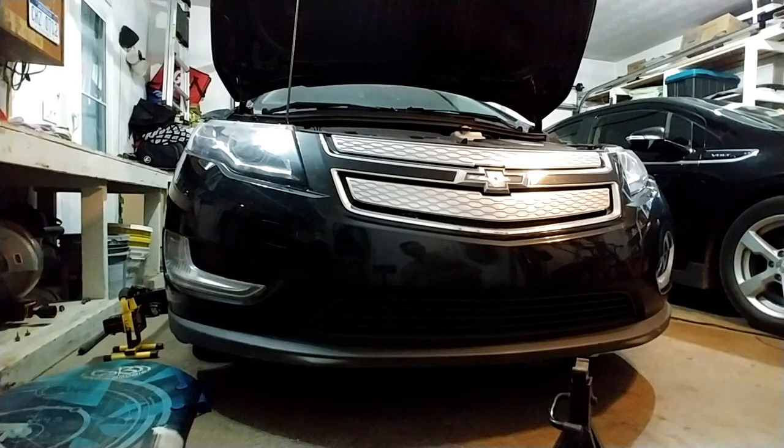All right, the next step is to drain the coolant. In order to drain the coolant from the engine radiator, you remove the engine coolant temperature sensor from the radiator. And I've done this already. Obviously it's refilled, so I gotta drain it again. It is a way to empty it, but it is pretty messy, so I'll try to catch as much as I can with my drain pan. One note of caution is to do it when it's not hot, and second of all, keep the radiator reservoir cap on. It'll drain slower, and it won't spray everywhere as it comes pouring out. I'll get us down to that step and then begin draining.